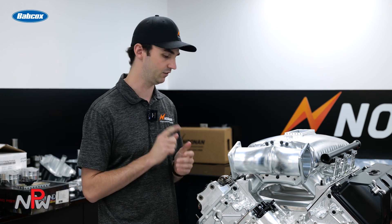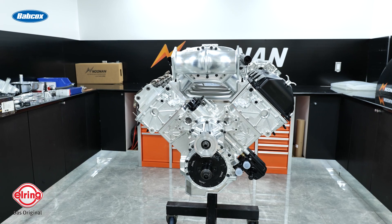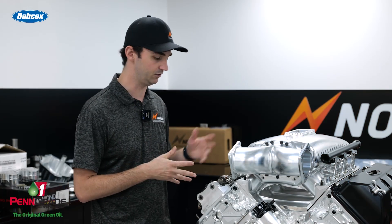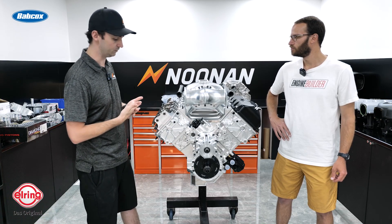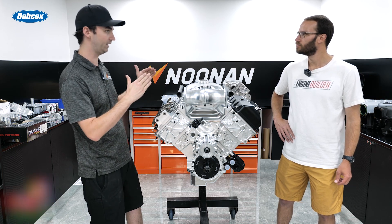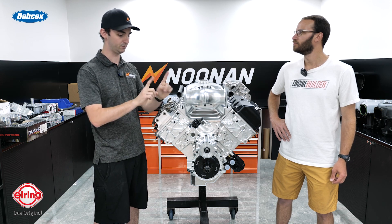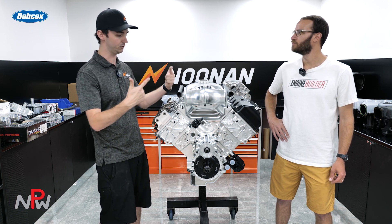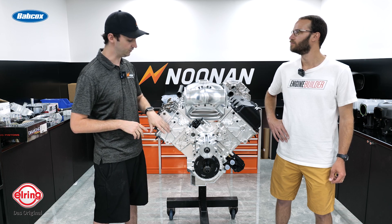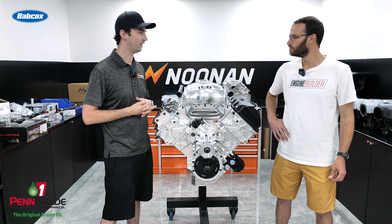It's just part of the things that make a 4.9 a touch better. But the other side of it is the serviceability of a 4.8 is a little bit different — not as bad on a turbo or procharger application like this, because you're able to pull the manifold and everything off pretty quick. Like we talked about on the 4.9, you're able to get into the bottom end much faster. As far as the machine work goes, the 4.8 block is going to have a traditional main cap design. There's some differences on a 4.9 where it's actually a splayed main cap — so you have a block where the main cap is angled, essentially pulling all the way around the main journal. It's a little bit better supported. There are some features here that are traditional with a 4.8 Hemi; the 4.9 is going to have a little bit more difference in engineering — our own spin on things.